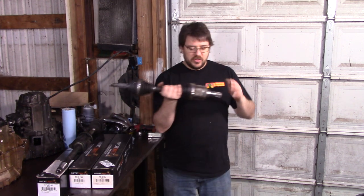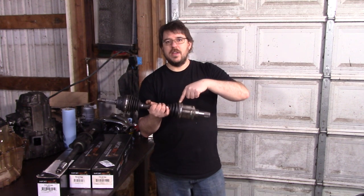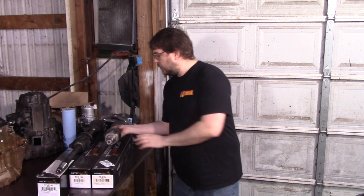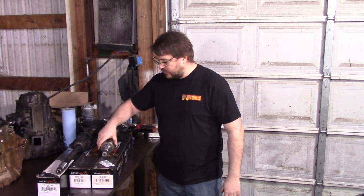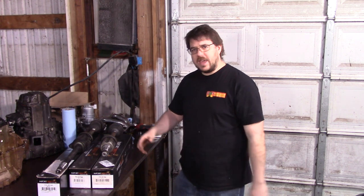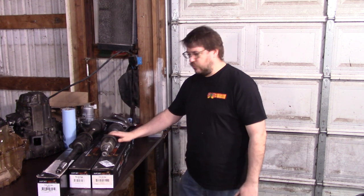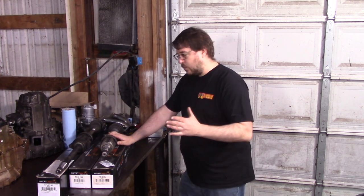The quality on remanufactured axles is sometimes hit and miss, and sometimes instead they'll just ship you a new axle made for the same application that you ordered from. But while the splines here and the splines here will match, the splines inside this joint here won't. And worse, this joint is usually smaller than this joint — it's just the way they commonize the applications. Would work just fine in the original application, doesn't work for us.